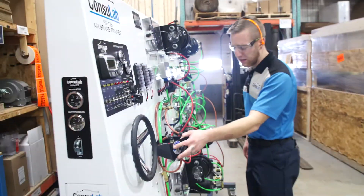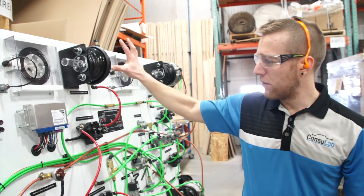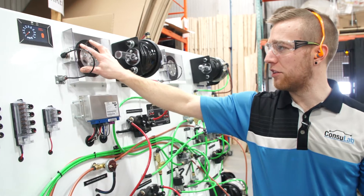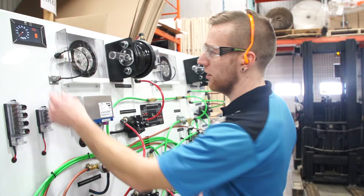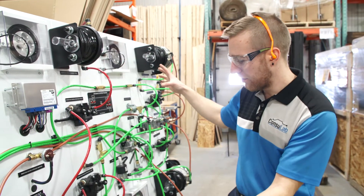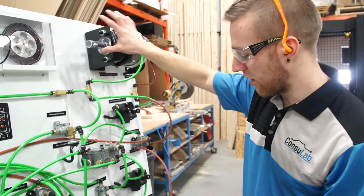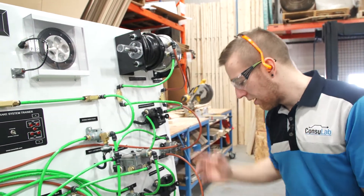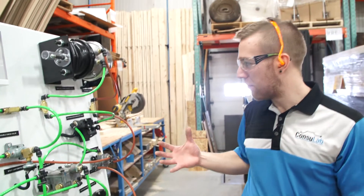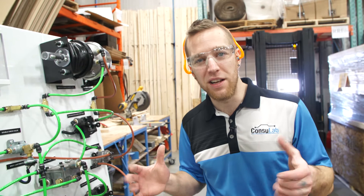Moving along, we've got our valves from inside the cabin of the bus. We've got our Bendix EC60 ECU, and you'll notice each one of the wheels — so this would be the front right wheel. We've got a digital display with the speed, the wheel that's going to spin up, the ABS sensor, and this is a real sensor — we can adjust the air gap just like in real life. We've got the brake chambers, all the types of valves you need: the modulators, the quick release, the relay valves. At the back of the bus we've got the rear brake chambers with the spring brakes, the air tanks and reservoirs, and all the components including the brake lights right at the back.